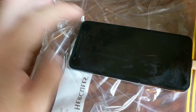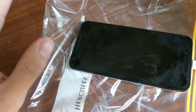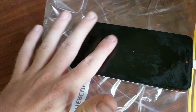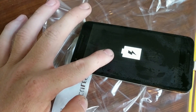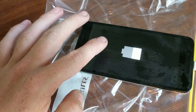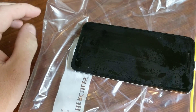It's been about three minutes and the orange light is still flashing — the battery is really dead. I think there's a very delicate thermal balance here. I need to get the phone cold enough that it boots, but I also need it warm enough that the lithium battery has some level of charge. And of course all this condensation is a terrible thing. Okay, it's just come up — we are successfully charging again.